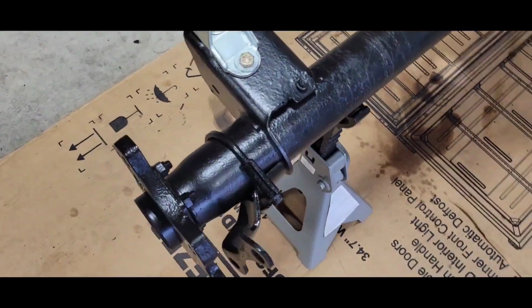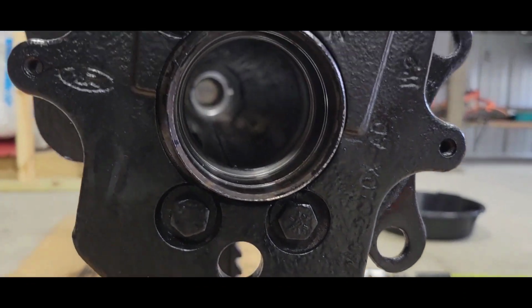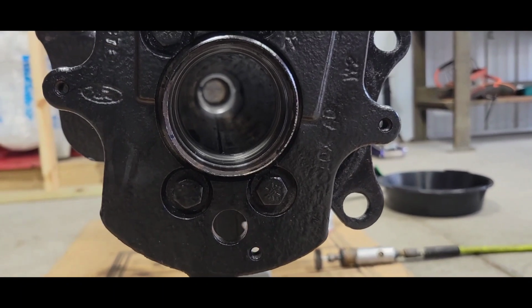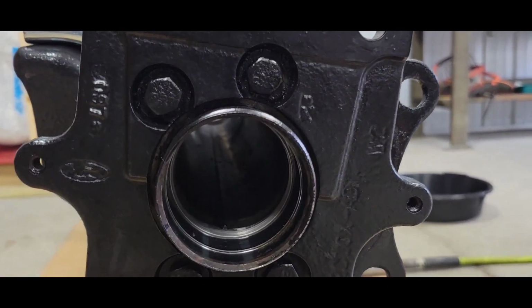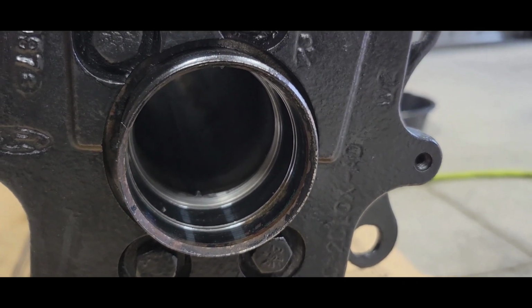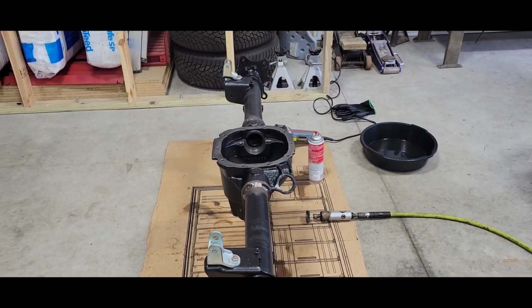I got the axle tubes clean. Sprayed those really good and ran a rag through there a bunch of times. Sprayed them probably three times and wiped them at least that. Got the bearing fits clean. I'm going to get a little bit of Scotch-Brite and hand Scotch-Brite it a little bit, and she's ready to assemble.